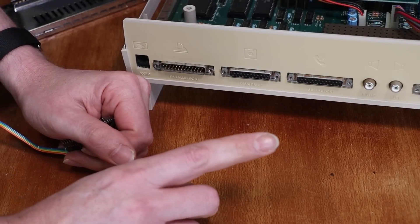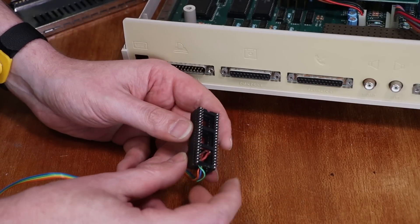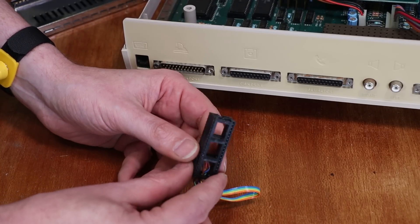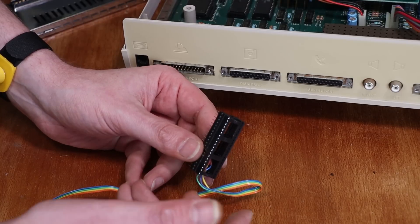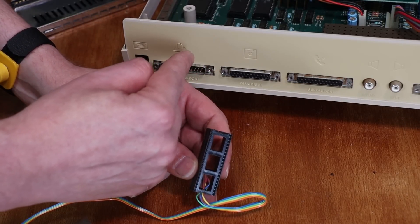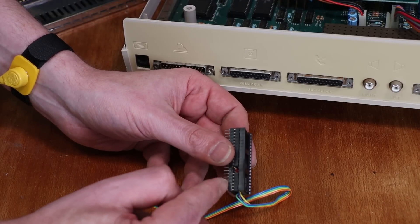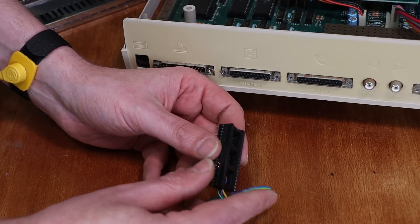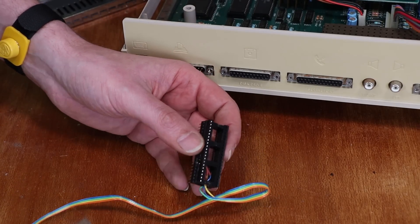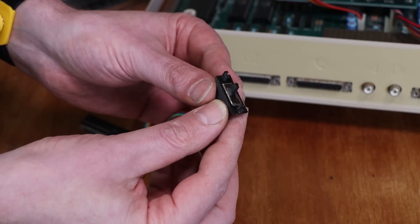So you may remember the small modification I alluded to at the beginning of this video, and it is this — a simple manual DF0/DF1 switcher. And if you're wondering why I'm using this and not the auto switcher I did in the 2000, it doesn't fit in a 1000 that has a daughter board — ask me how I know. So this is a simple one, just made from some sockets, some wire, and a switch. I'll put a how-to down in the description.